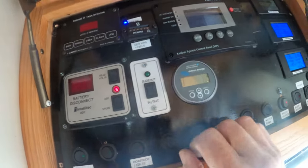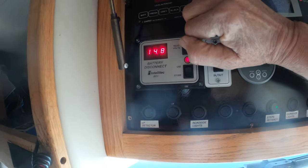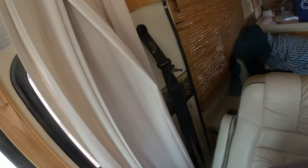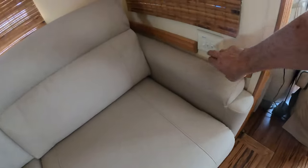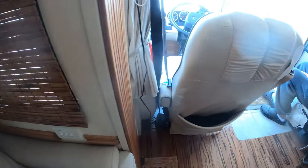Slide in and out. The battery disconnect disconnects the house batteries from everything. LP detector is for the propane detector — it should always be on if you're occupying the coach. Roadside lights are the highlights on the side. This switch here — security — also turns on those. They're called scare lights, so if somebody's outside and you want to run them off, you kick it on and it kicks on the scare lights.